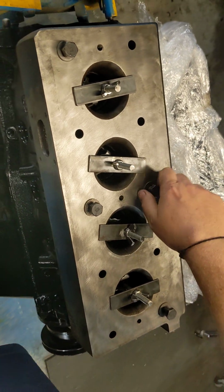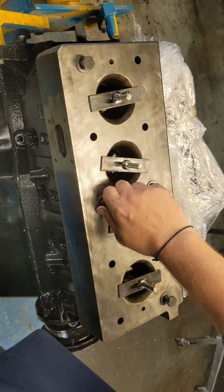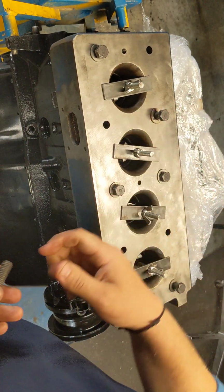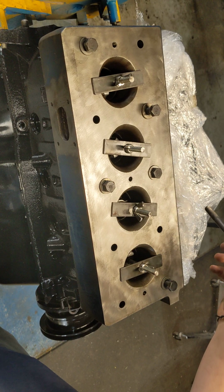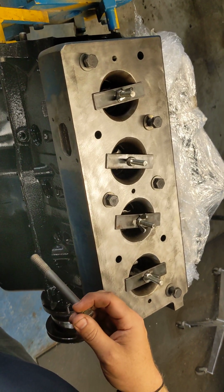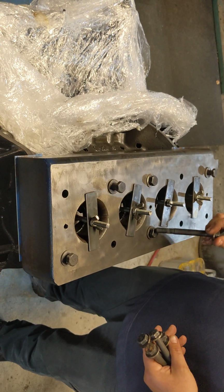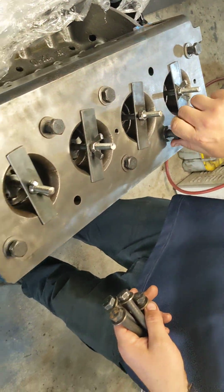And then Gavin mentioned a little bit about the torque sequence and what needs to happen with the head bolts. There's a little bit different procedure for that, isn't there? You've got 2 different torque specs. You want to do the initial torque spec upon reassembly. You've got a 60 foot-pound torque spec for your head bolts and a 23 foot-pound torque spec for your intake bolts. Then after everything is assembled, you want to run this thing up to temperature. You want to get everything nice and hot, let all those gaskets seat and seal, and then once it cools back down from your initial run up to temp, you're going to retorque the head bolts to 70 foot-pounds, and you're going to retorque the intake bolts to 25 foot-pounds. And that'll ensure that everything stays seated and sealed.